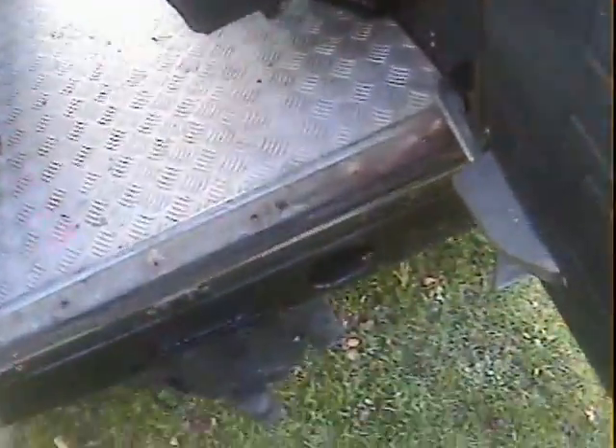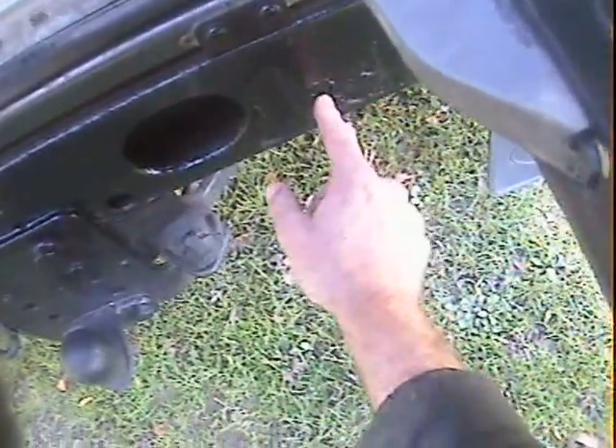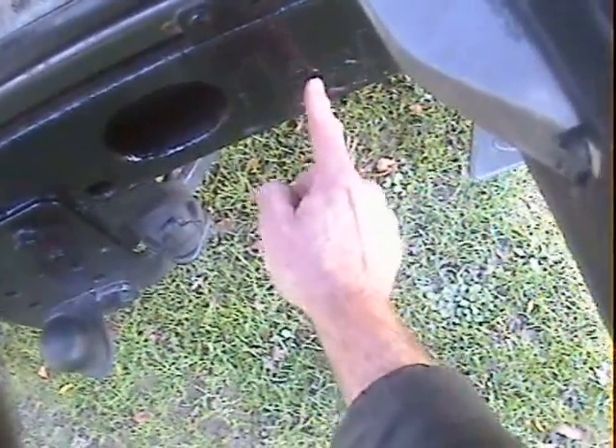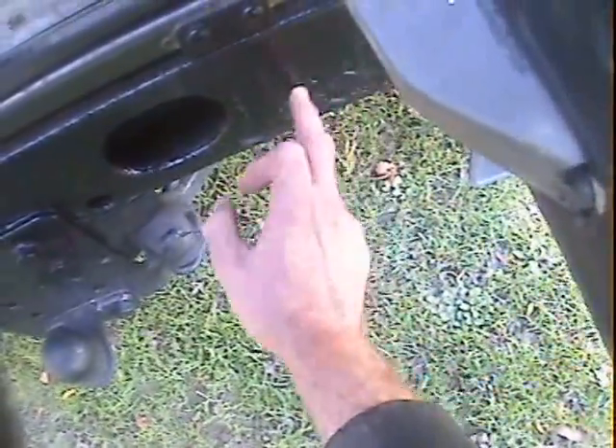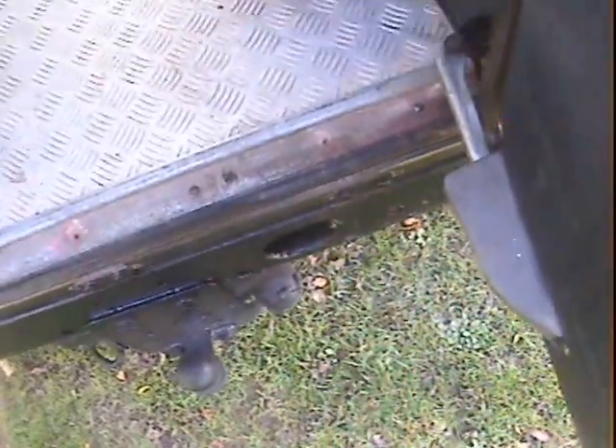The tailgate is nice all down here, but at the bottom of the tailgate frame there's a hole I can get three fingers in. Otherwise it feels pretty good — it's just there that it's started to rust through the bottom frame, but it still holds the tailgate up with no real movement in the hinges. One thing to note: the rear cross member will probably need replacement in a couple of years because it's started to delaminate, and there's a tiny hole just there — that one shouldn't be there. It feels solid still, but that section really could do with repair or the whole cross member replaced.